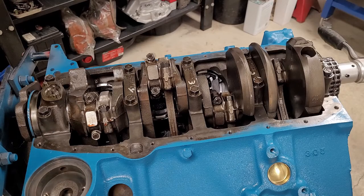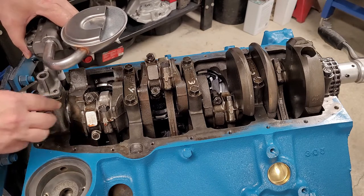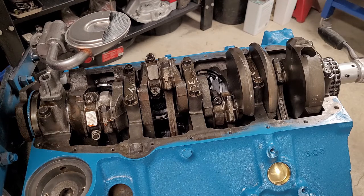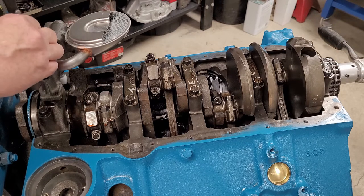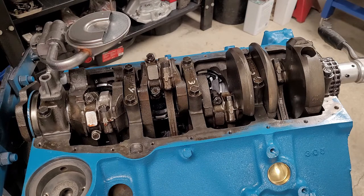Okay. So when we're setting the oil pump in, obviously we're attached here. We'll go through the drive hole through the main cap there. Okay. Then we're going to set on these two dowels. Perfect. Now, just to double check everything, because I showed you the bolts already, the differences. If you just want to make a quick measurement, check here. So that's the depth, and that's to the top of the back main. We don't want to hit the main. Let's take a look at our bolt.